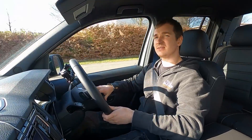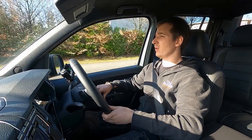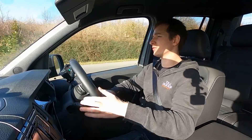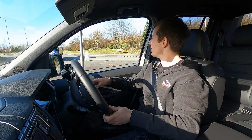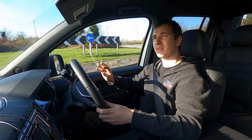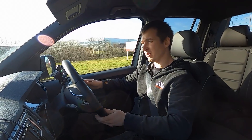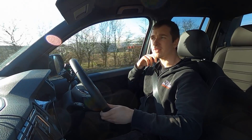We've probably spent a week messing about with this gearbox tune trying to make it behave and do what we need it to do - getting rid of the limits that are going to cause problems when we start pushing it harder, because once you get past those limits you'll get transmission intervention and we don't want that. It's not just about how fast it changes gear - there's quite a lot of calibrating, slopes between gears and loads of other things, so it can take quite a while.